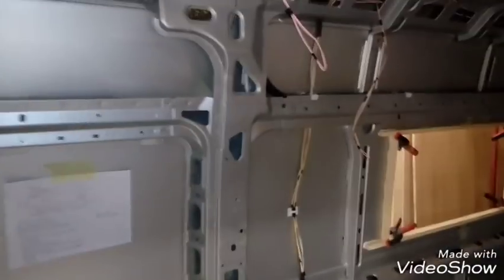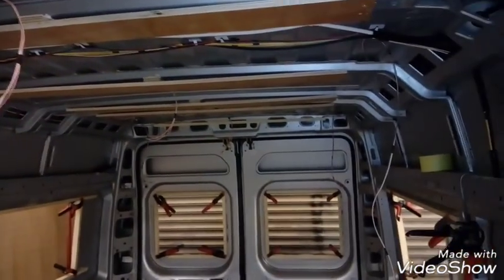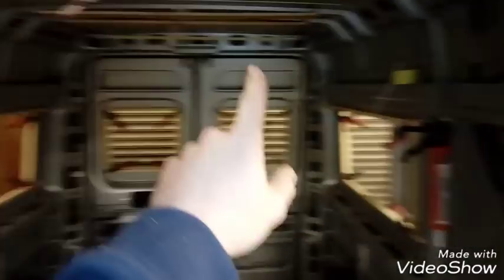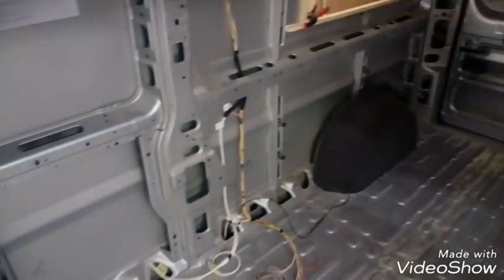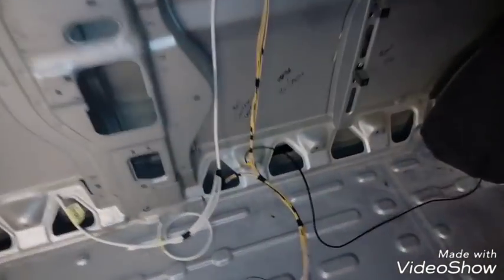Right, so look at what we've got so far. We've run the wiring in 12 volt and 240, and you'll see the light feeds dropping down there in the corners and in the middle. We've got coaxial cable running in because the boost is going here with the aerial, and we've got the actual socket and plug-in point for it down on the side next to the flap on the end of the kitchen.